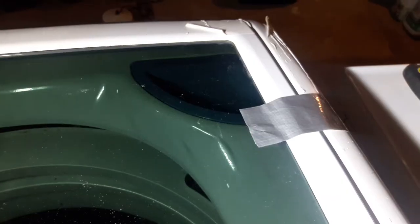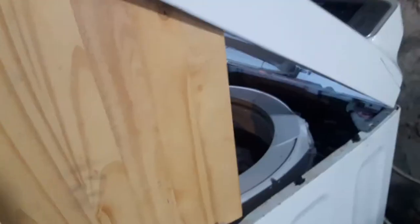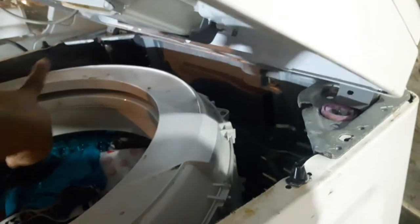You want to see the hole behind that drum — push the sensor through it. Then go to the front of the machine and tape the door down. Once the door is taped, use a butter knife, spatula, or flathead screwdriver to lift all around the edges of the tab to pop it open. Then pull it towards you and it will fall into the little metal grooves on the right and left.